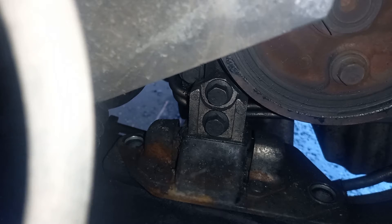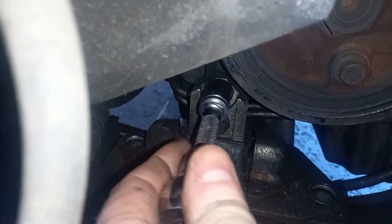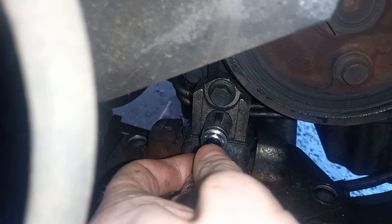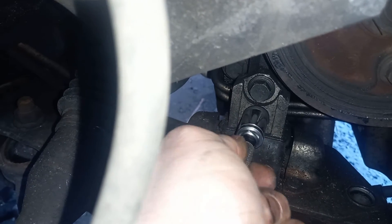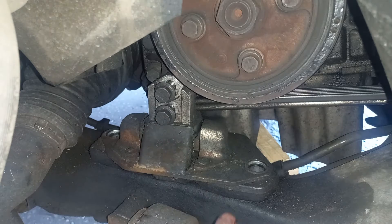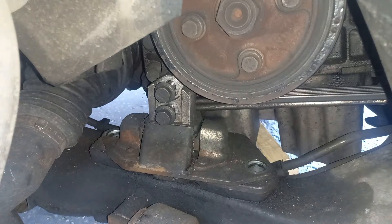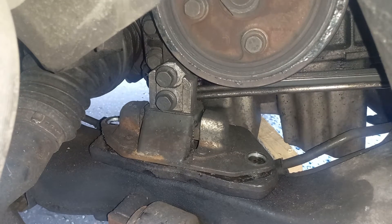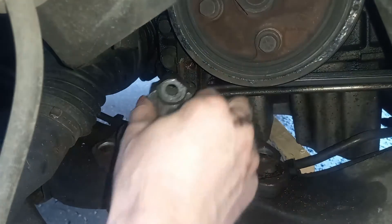Last two now — these are nice and easy, they're just 14mm. But a short extension bar is going to help you to get over the edge of the subframe there. I've loosened these two bolts off, but before I fully remove them I'm just going to prop up and raise slightly the engine. And with these two bolts out, that's actually going to help us get the old piece out. Now I can just unbolt these and take the old unit out.